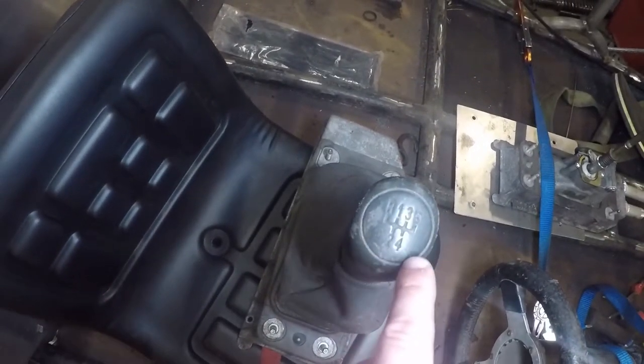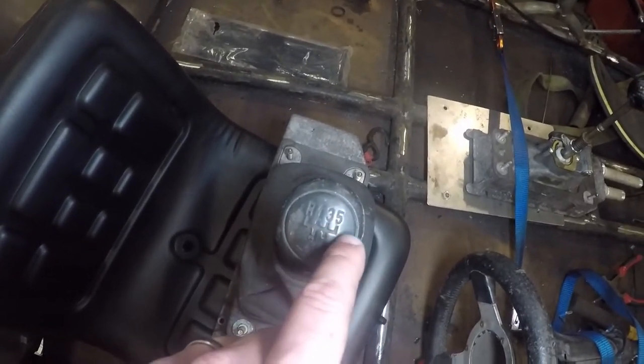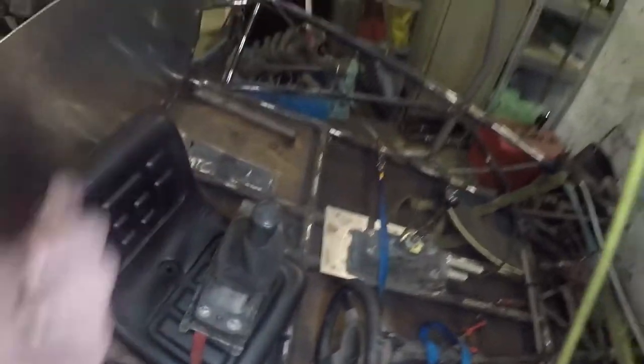It's about three weeks later since I made the intro. Lots has changed — still working on the gear selector on and off. The weather's been nice so I haven't been in the workshop much, but I think we've got somewhere. First thing I did wrong: the selector pattern from a Fabia is not the same as a Passat. Reverse on a Passat is down below fifth, so a Fabia has four gates across whereas the Passat only has three. Not a problem because the gear stick doesn't have gates — the actual gearbox does. I've changed to a knob with no pattern on it.